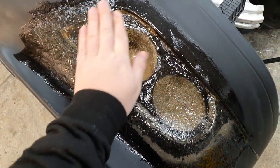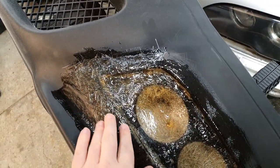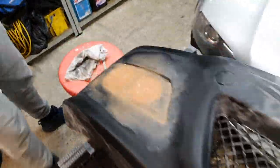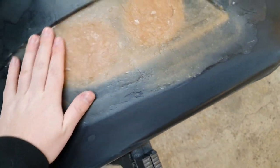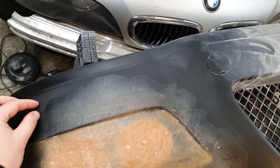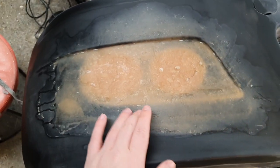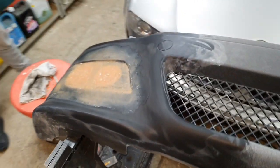This is now a new piece — I literally just cut a small piece of fiberglass, mixed up a tiny bit of resin, put it on, waved the heat gun around, and now it's all nice and dry. Everything is now good on this side. John's been sanding this down by hand and as you can see he's done a nice neat job. With the smooth filler we'll probably take a bit more sanding off here and there, put smooth filler over it, bring the filler down to this bit and over this bit here. Then wet and dry — that'll be lovely and smooth.